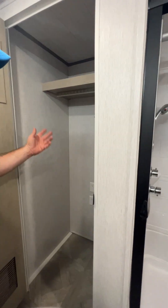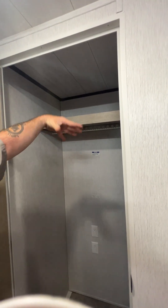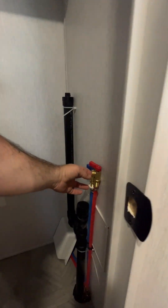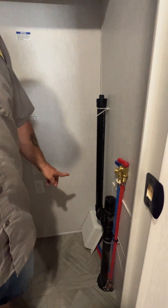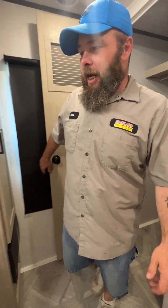Inside here is where your washer dryer area would be located. Certain models are stackable — this shelf may have to come out depending on the size. You've got your washer hookups, hot and cold, and your drain is located up here. And like I said, it's just direct ducted, so you have to have that cap off or all that water is just going to backfeed right into the side of the coach — and we just don't want that.